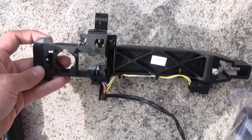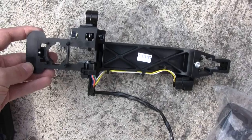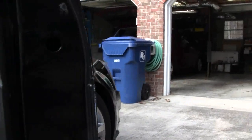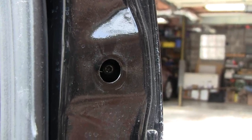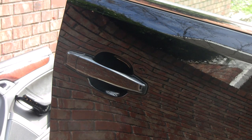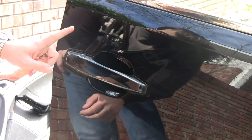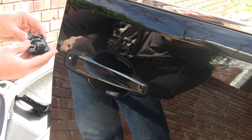Now that I've confirmed that one of the switches is bad, we can go ahead and replace it. The next step is to remove this little rubber plug in the door, and there is a screw behind it that needs to be removed. We've removed that screw from the side of the door. Make sure that when you're getting to the end of the screw, you reach your hand up inside the door cavity from the inside and keep that screw from falling into the door. That screw releases this piece here, so if you pull on the handle carefully, it will come out now.